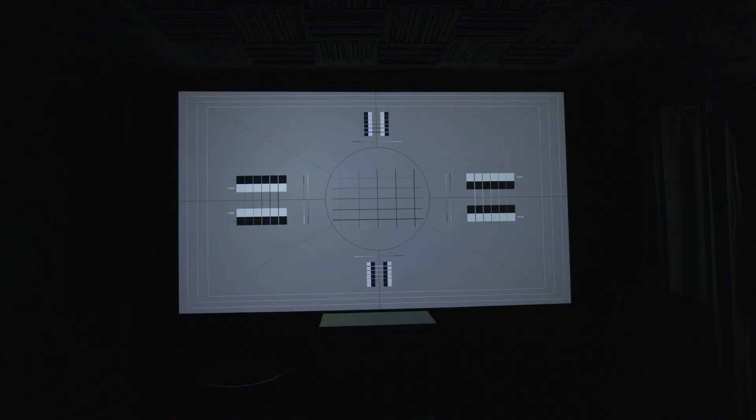Under contrast, it displays a contrast pattern which includes a series of blinking numbered rectangles. Lower the TV's contrast control until all the rectangles are visible. If you can't make all of them visible no matter how low the contrast goes, lower it until as many as possible are visible. Once you have all the rectangles visible, increase the contrast control until at least one disappears, then lower it one notch to bring back those rectangles. For sharpness, the basic process is to turn it up until artifacts appear, then turn it back down until artifacts aren't visible anymore.